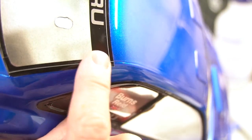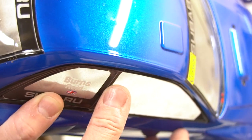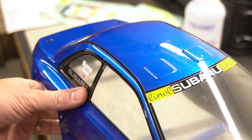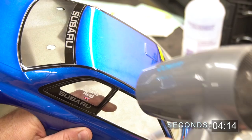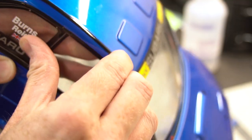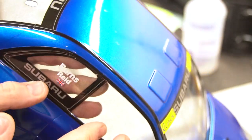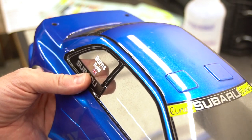There's a piece of trim that comes along the top here — you can see it's a somewhat complex curve and it's raised up a little bit. Let me show you the before and after with the hair dryer. Right now without it the decal is on but you can see the issue — then I'll hit it with the hair dryer. After softening it you can really see the difference: now it truly looks like it's part of the body, curving over there really nicely.